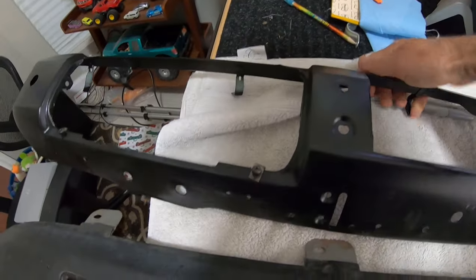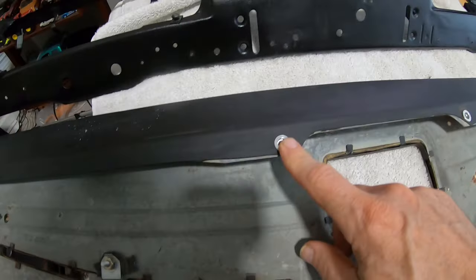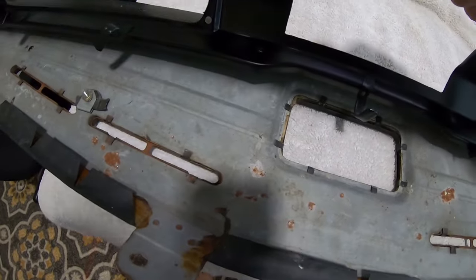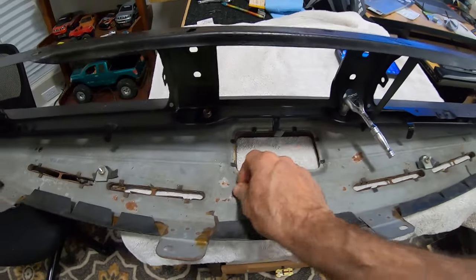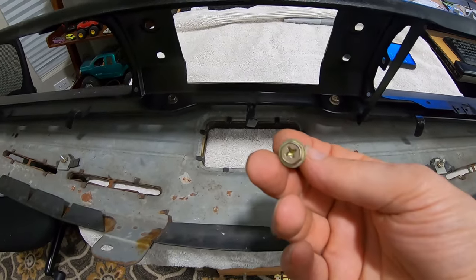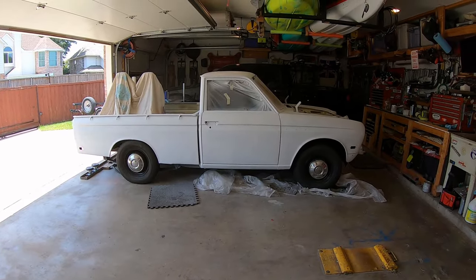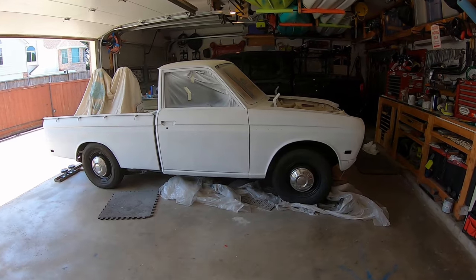I haven't got the right nutsert tool — I need a 4mm nutsert for there. But I do have the nutserts in here — these are 6mm. I think the glove box is 5mm. So anyway, I'm just going to bolt the dash back using the nutserts and some old 6mm Nissan bolts. Here are the new bolts to hold the dash two pieces together — a little 6mm bolt with a 10mm head and a lock washer. So much easier to assemble now. Don't forget to like, subscribe, and comment down below if you want to see more. Truck's coming along — one coat of white paint, no clear coat yet.